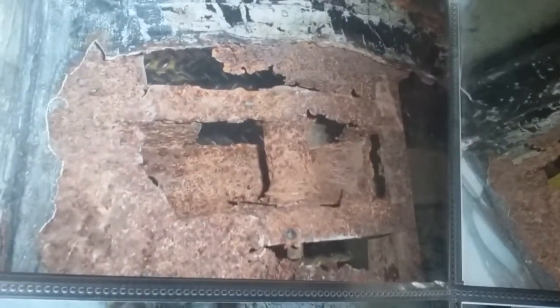and I'll show you why. That's the trunk floor looking at the driver's rear wheel. There's the box, the frame that holds the leaf spring in place. There's the leaf spring. There's the spring trying to come through the trunk floor. Another view of the trunk. Big frame rail. So what we did was we just cut the whole trunk out with an air chisel. And yep.